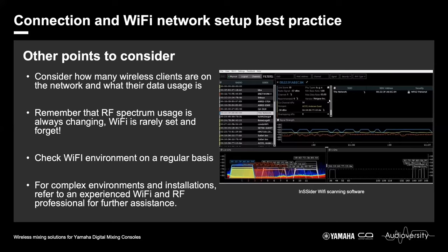It's important on a daily basis to actually scan the Wi-Fi spectrum. One of the better Wi-Fi scanning software tools, available for both Mac and PC, is called Inssider. However, such software only scans for Wi-Fi devices — it won't tell you what other non-Wi-Fi devices may be using some of that spectrum. At that point you need professional RF scanning devices. Regularly check your Wi-Fi environment, sometimes even on an hour-to-hour basis. In a more complex installation using multiple routed subnets or multiple Wi-Fi access points, it's worth consulting a professional.